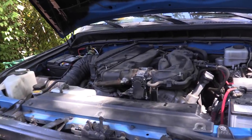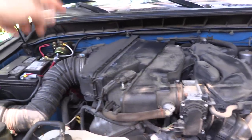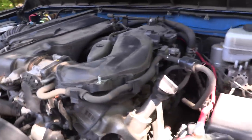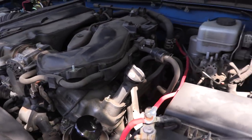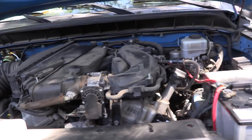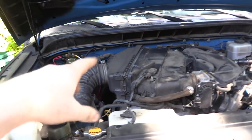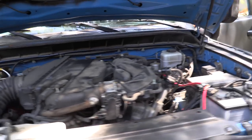That's a wrap on the oil change. Next, we're going to change out the intake air filter and the spark plugs. Underneath the air filter you have the passenger side bank of spark plugs, and over here you get access to all those spark plugs. It's not going to be real fun pulling the plug coils off and getting the plugs out of there, but it's going to be worth it. I'm going to start by removing the air filter housing, pull that aside, and then we'll start pulling all the plug coils.